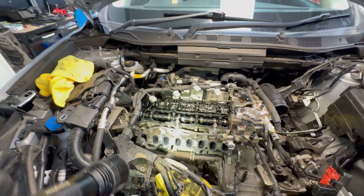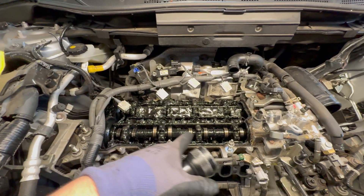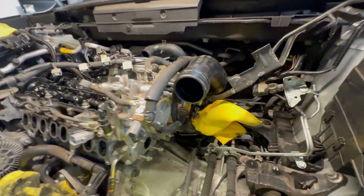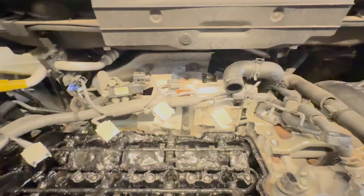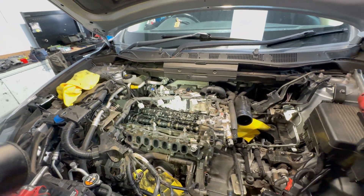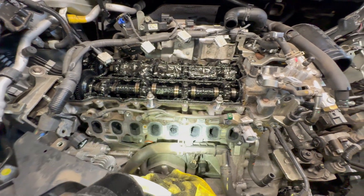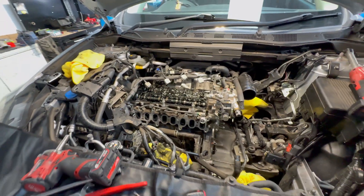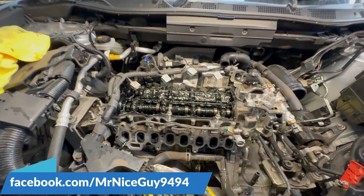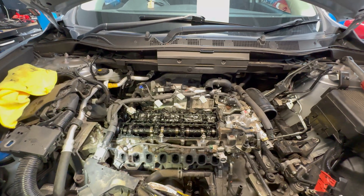On the next step I'm going to remove all that dirt alongside the camshafts and the rest of the parts, get everything cleaned, change the vacuum pump, the exhaust pressure sensor, and unblock the metal pipe underneath it. Then I'll show you the carbon cleaning results, followed by fitting the new bearings. After that we'll take the car for a test drive and hand it back to the owner.